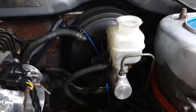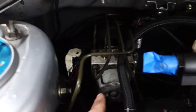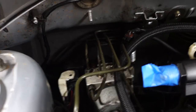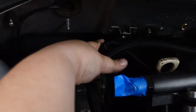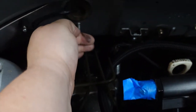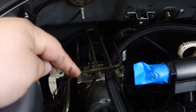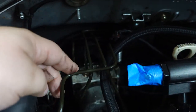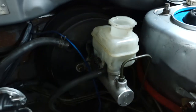A little bit might come out when we start removing lines. We have to take out the brake master cylinder next, and then we're going to work on the module over here which we have to take out, along with some of the hard lines. There's a plate back there — the hard lines are behind it, so we have to take that plate off. There are six lines going to the module.